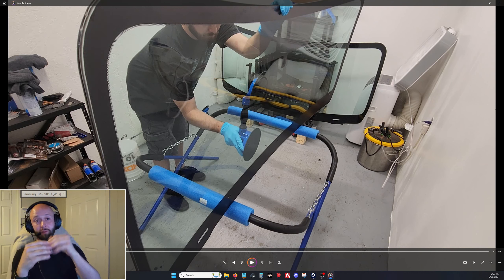Go all the way around the glass and end at the right edge of the right gap hole, leaving a gap on each side. Then do another bead at the top connecting those gaps, with the gaps being a few inches wide. Do a final check for smudges, dust, and lint — look under the glass, look up at bright lights — for both panes before setting them up.